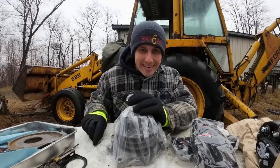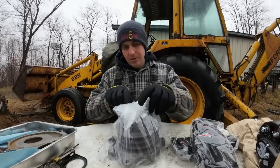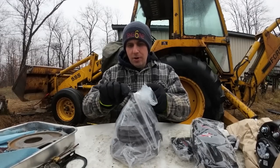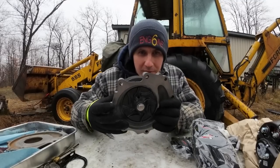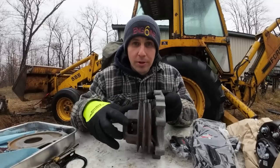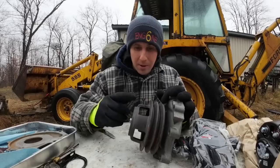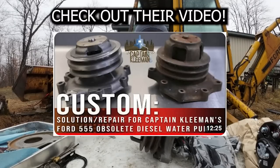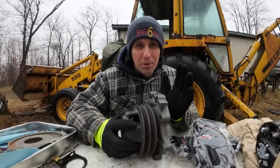They tracked it down and found out the water pump we needed for this particular 201 is obsolete — you couldn't find it anywhere, and they looked everywhere. So what they did is they took a new water pump that had the same bolt pattern and casting, found one with matching bolt holes. The problem was the pulley wasn't matching up, so they took the old pulley off the old water pump and married the two together.